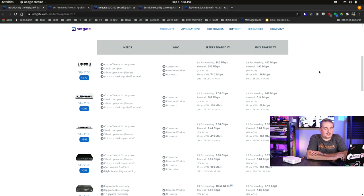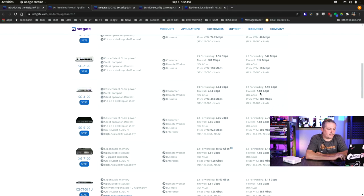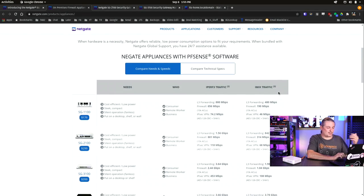That's because the traffic from doing a speed test is not the same as actually functioning. You may have a device that can speed test really fast because it can handle a single packet stream faster than it can handle a mix of more realistic traffic. On the comparison chart, you go from 74 to 118 on iPerf and 46 to 68 on iMix — so you get a speed bump over the SG1100, not just more memory but a little faster processor. It's still not as fast as the SG3100, so if you need more VPN speed, especially with more people working from home, the 3100 will get you a little more speed.